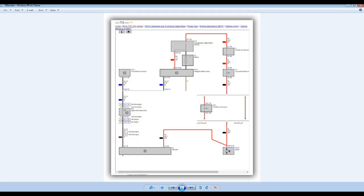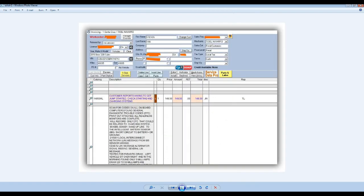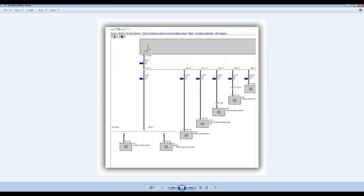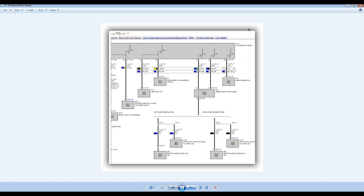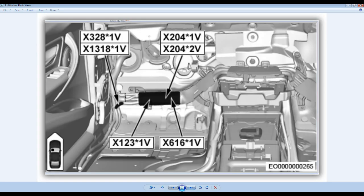However, here's the same type of picture, generic. But when you check out the LIN communication, look at this here. How many? This is only one part. Those are connected on that. The intelligent battery sensor here on the left. You see how many tie in on that one? And these two. So there are like 10, 15 modules on it. All those modules are tied into that network. And right here is a supply connector. This is where I wanted to go.